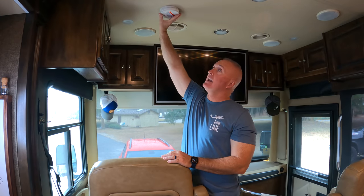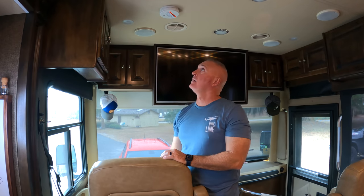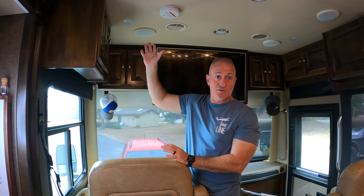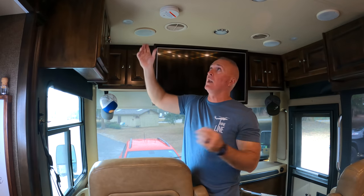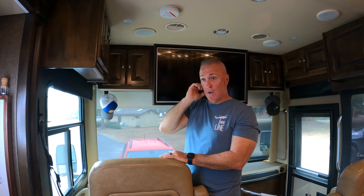Another life safety check is the smoke detector in your rig. Ours is up front above the driver's seat. It's great to test it at the beginning of your trip and at the end just to make sure it's working. A lot of people don't know that it's not hardwired — you do have to change the battery out, and it's just a nine volt battery. We test ours weekly when we make toast, so we know that it works. To test it, you just push the button and hold it. That is ear piercing — it will wake you up, trust me.